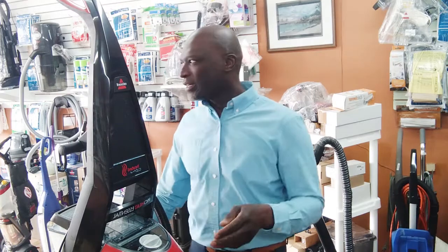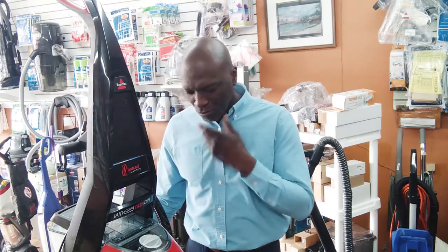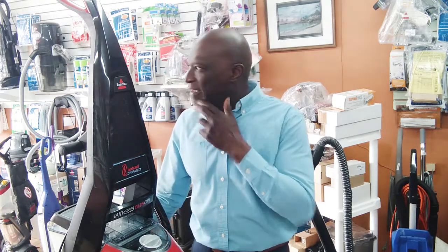All right. So with the shampooers, it seems like we do videos about shampooers more than the others because I'll be honest with you, vacuums are fairly simple. They're making them a little bit more complicated now, but still, vacuums are fairly simple. It's brush, belt, bag, on and off switch, motor kind of thing. Shampooers have a couple more things happening all the time. So I'm going to give you what the basic problems are that a shampooer is going to have, and then we're going to focus on the suction alone. But I just want to give you an idea.